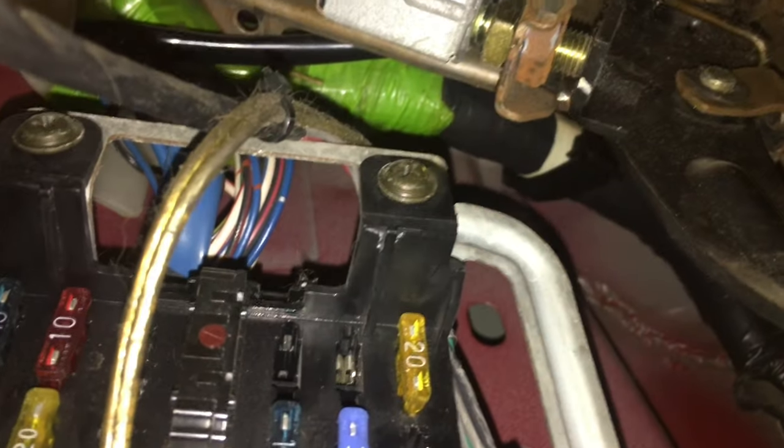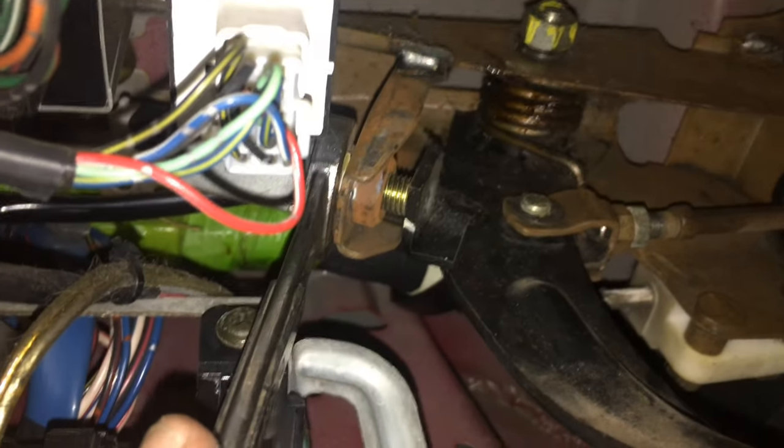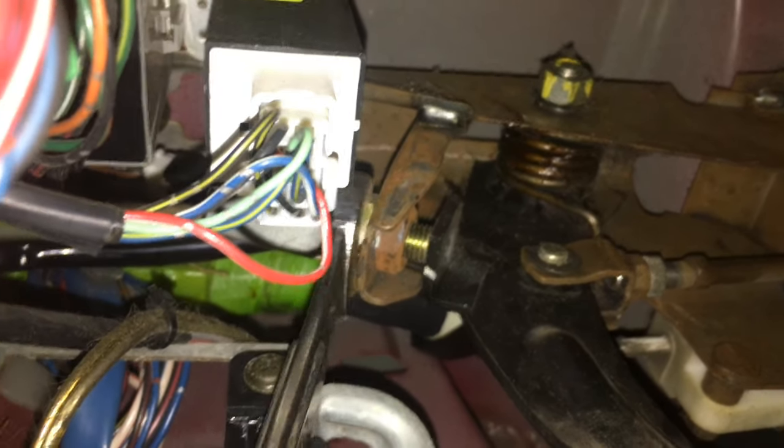I like mine just a little tight - basically I want it to engage almost the minute that I touch the pedal. And then this right here is a 17. Just go ahead and grab the 17. As you can see, we're tightening it down there. Now it's good and tight. Sorry about all the noise.